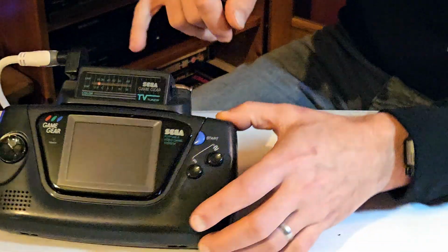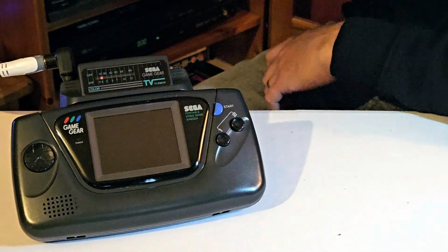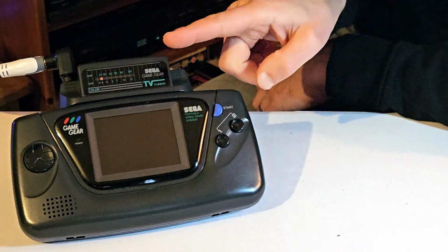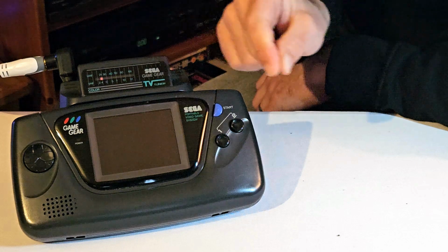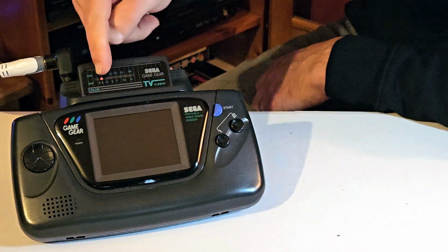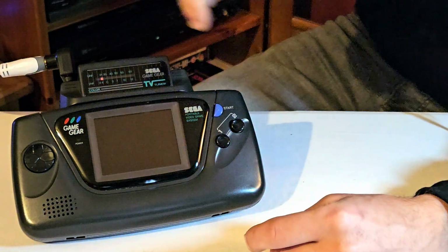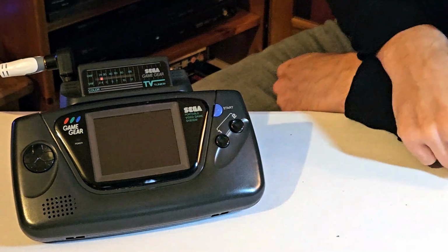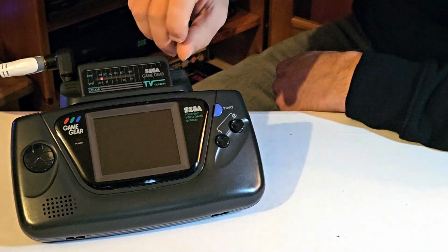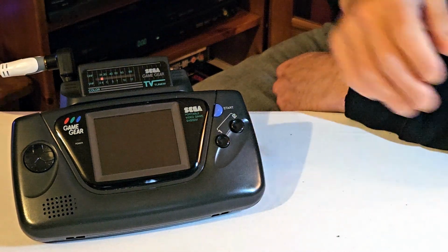And then there's a little wheel on the side that moves your mechanism on the inside. Now, one thing I will stress, one of the faults with these is this little orange indicator here. It sits on like a toothed piece of plastic that moves around. So as you're moving this, you're moving these teeth around, and that moves the indicator up and down. And they're really prone to perishing, especially when they've been sat for a while and they're so tightly turned round inside here. So if you just move this really fast and vigorously, you'll risk breaking that and it just won't move anymore. So if you've got a working one, just move this very slowly and very carefully. Unfortunately, if it's broken, that won't move, but you will still be able to tune in with the tuner.